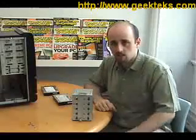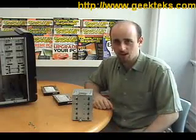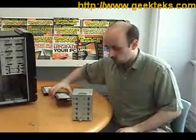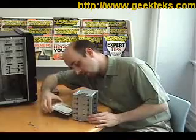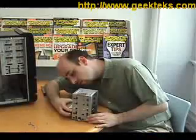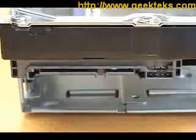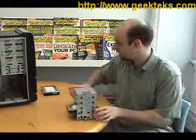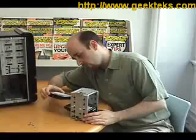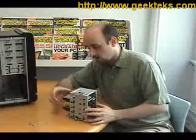When you're putting the hard drives into the hard drive cage, you might want to leave some space in between them for air circulation, because hard drives do get hot — especially if you're doing things like video editing, audio editing, or playing games. So we're going to start by taking our 400-gigabyte hard drive and putting it in the fourth slot, just sliding it in between the metal railings until it reaches the end. You'll notice that the data connector and the power connector are on the side facing into the case — that's very important, otherwise your hard drive will not do much of anything. Now we're going to take the 250-gigabyte hard drive and put it in the second slot exactly the same way.